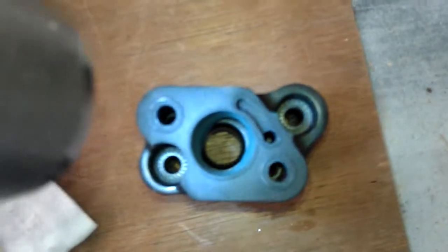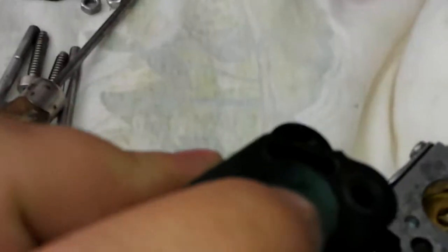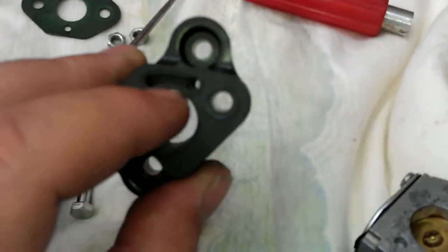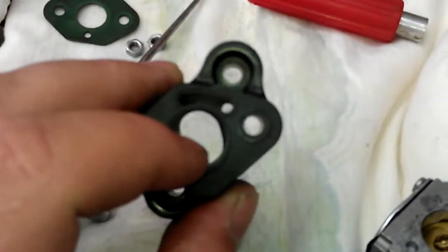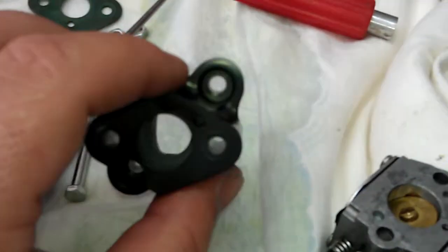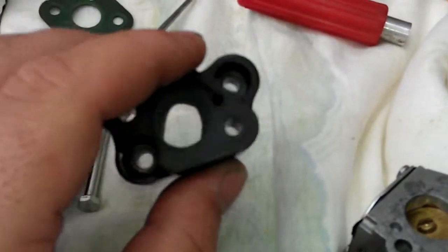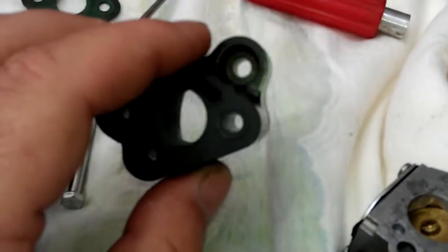You want to be really careful when you're doing these. If you do it too fast and you burn it, you really risk a chance of cracking the material. When you're working on your side that has your pulse hole, be very careful with your material around in here. If you go too fast or you start burning it — and you'll know what I mean by burning, that's a smell you'll never get out of your nose for about a week — you risk a chance of cracking it on the inside. Your motor will run like crap and you'll be going, what happened? What happened? You've cracked the internal on the inside of your manifold, so your pulse hole is screwing up and you're not getting the correct signal all the way to your carb.